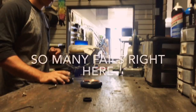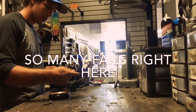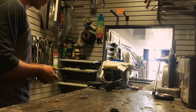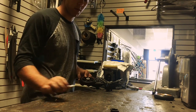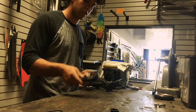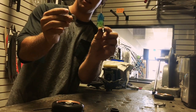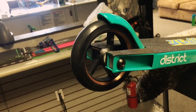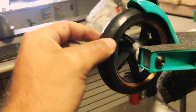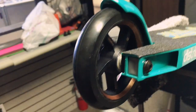So how can you tell if your wheels are ovalized? There are a couple of ways. The first way is your wheel can get this — the bearings are supposed to be in, but they popped right out. That's supposed to be snug. The second way: when the wheel is fully on, if it still wobbles even when it's fully tightened down — hear that? That means the wheel is ovalized.